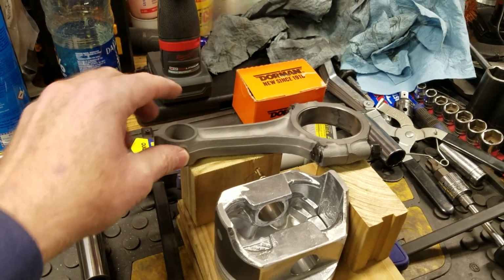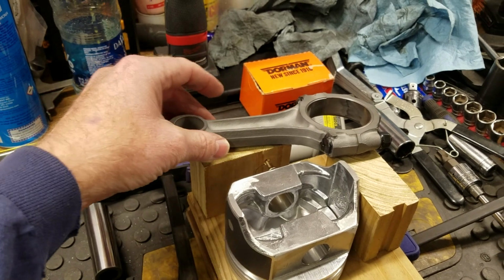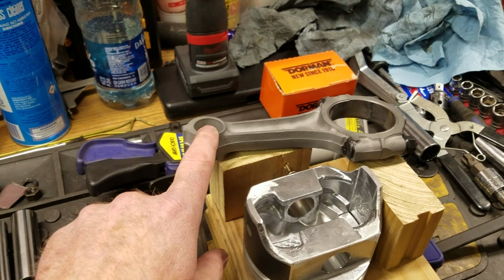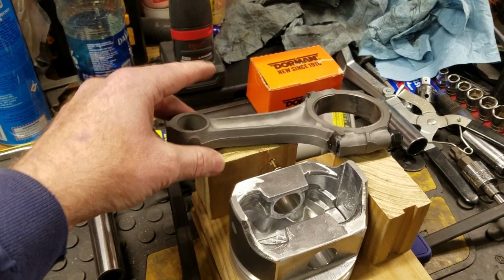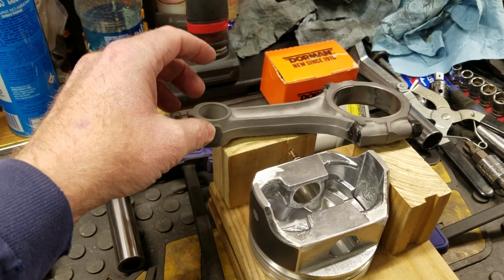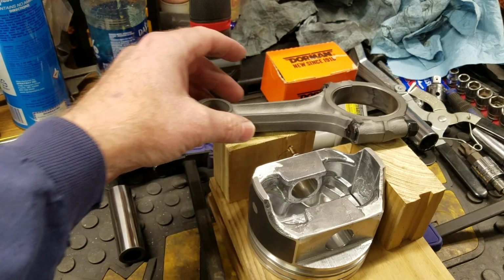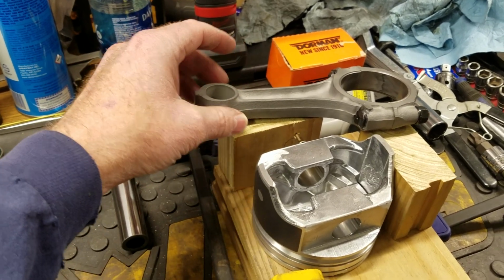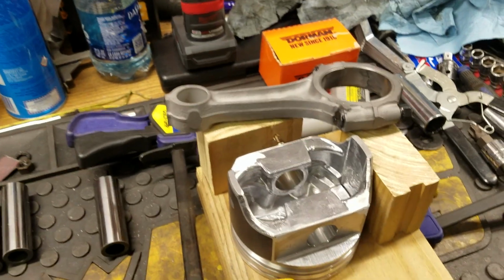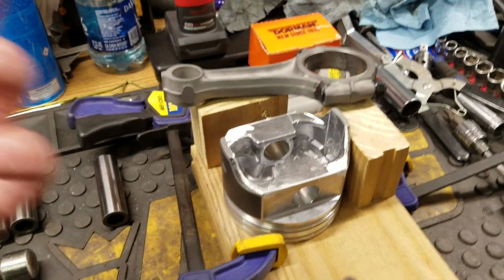It gets pretty blue. Then I keep going for about another 10 to 15 seconds, and you'll notice that the bluing kind of goes away. I don't know how to explain it, because when you first hit this with the torch, you're going to see it sweating. You're going to see the moisture come out of this thing. Then it takes a good amount of time before it starts to brown, and then it starts to blue. Within 10 or 15 seconds after that, you'll notice that it starts to come back to the gray again in a way. It's really hard to explain, and I really doubt the camera's even going to show it. But being in person, that's what I see. And that's when I know it's time.